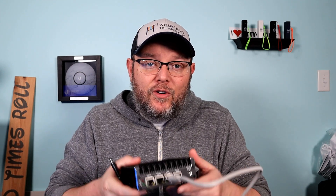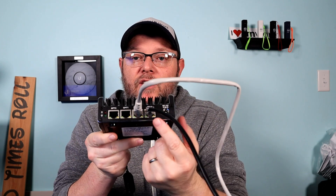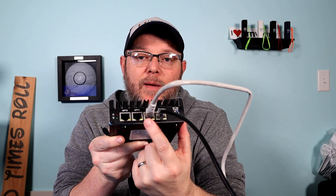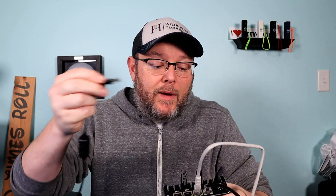You're going to want to make sure you've got no other routers plugged in, which is why I suggest when we first start doing this, this goes directly to your computer. Then you need an Ethernet cable that goes to your internet source — whether it's a cable modem, DSL modem, Starlink, or whatever it is — and that cable goes into the WAN port. So now you've got a cable in your WAN port and a cable in your LAN port. You are now ready to go ahead and plug the power in.